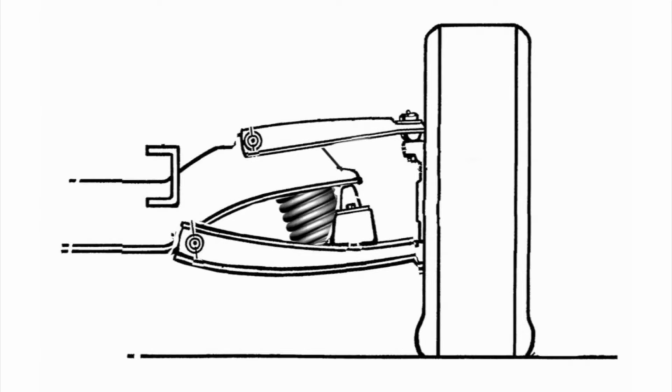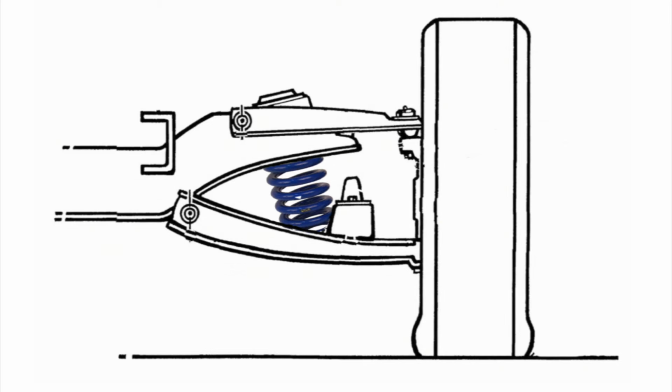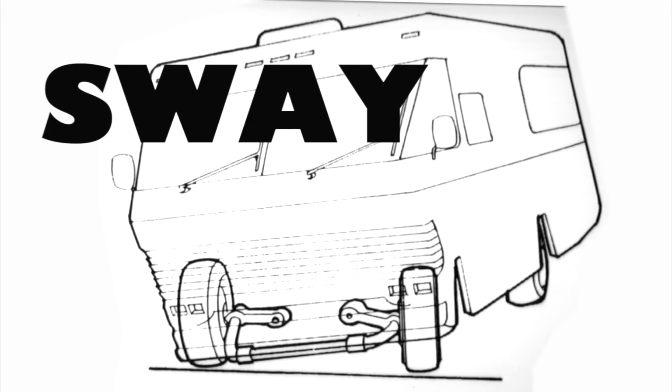One point of caution, sometimes on coaches with the factory springs, they would come in with the airbags totally flat and then the front suspension riding on the bump stops. After we fixed the front springs and got them some more travel back in the front suspension, we would find that the coach now had a bit more sway than before.